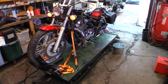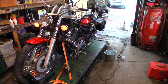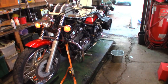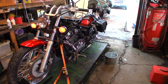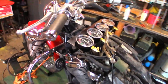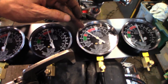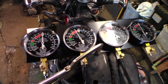This might be hard to hear — it's got Vance and Hines pipes on it so they're quite loud. I'll go into the details after I shut the bike off. Let's walk over and see what the gauges are doing. Have a listen to that idle — it's a little choppy; once in a while you hear a pop in one of the pipes. This is what we're reading for our synchronization. This carburetor is pulling more vacuum than this one, so it's basically idling on one carburetor.